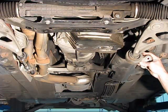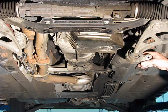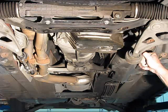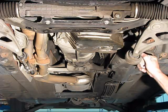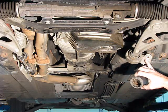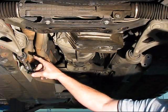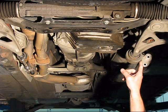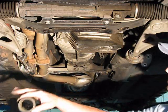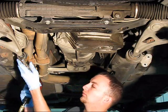The project we're doing now is actually replacing the control arm bushings on an E46. What we have here are the actual bushings, and this is the amount of play that you have with these things when they're totally worn out. What we're going to replace is just the bushing component that's inside the bracket. On the other control arm, we've already removed the outer bracket — this is the outer piece of the bushing with the bracket. Now we're going to use an impact gun and a puller to pull the remaining component off.